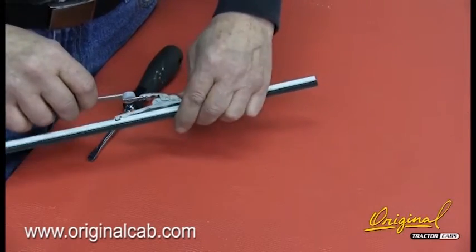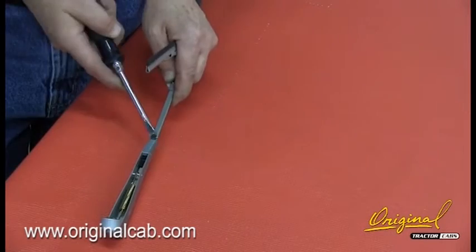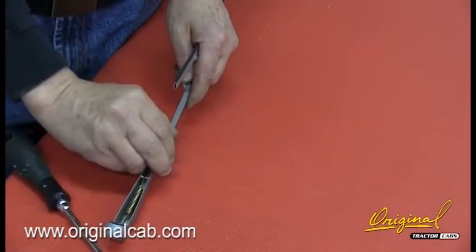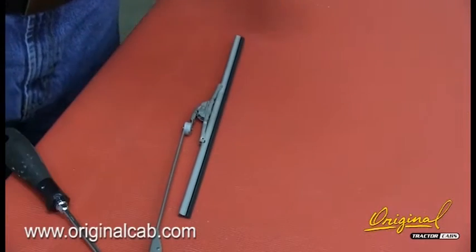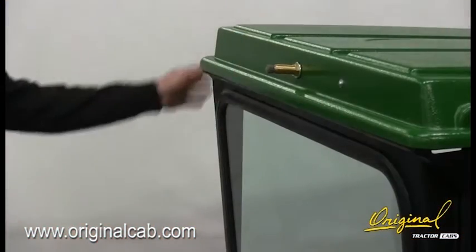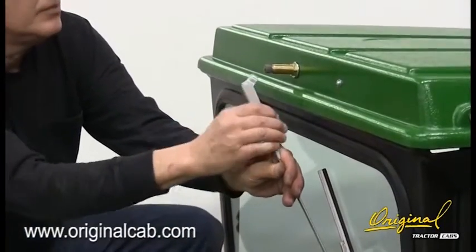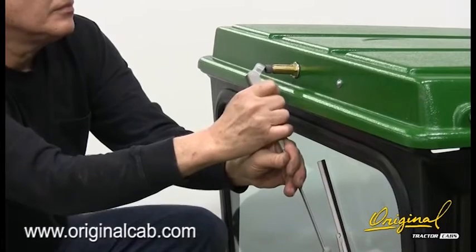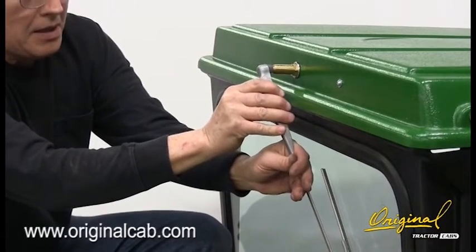Attach the arm to the blade by pulling the spring clip back and placing the arm into the notch. Turn the motor on and then off to ensure that it is parked to the left as seated in the cab. Lift the gray lever on the underside of the arm and extend it fully.